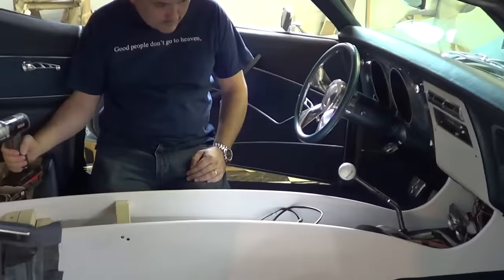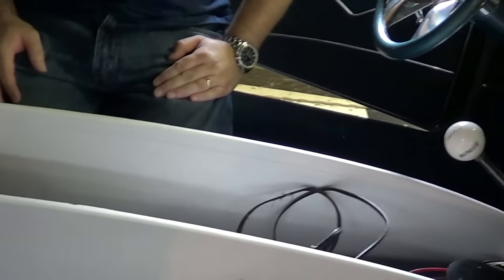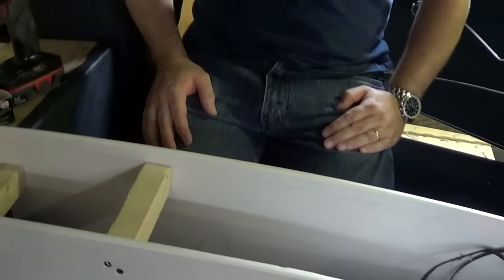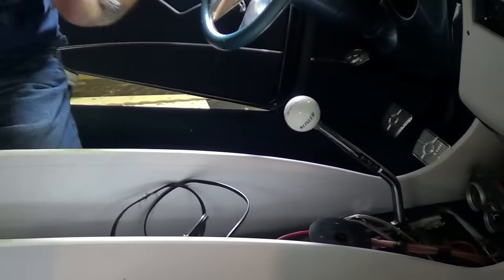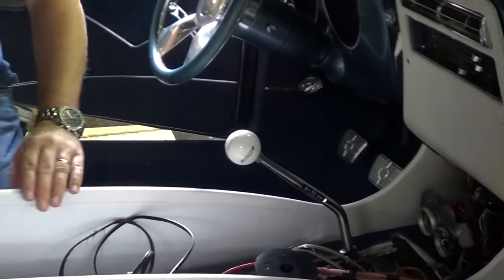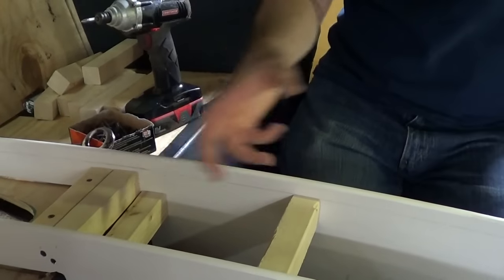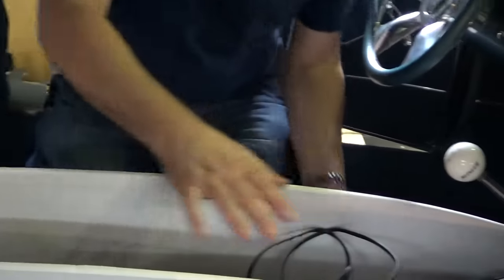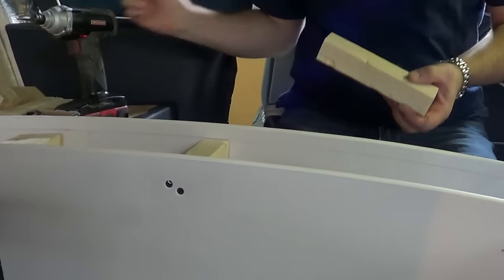Tim, boom — we made that cardboard turn into plastic. So you just laid those cardboard pieces on there and cut them out of PVC foam sheet. Now you're putting braces in there. I had to router these edges on a bevel — the bottom edge to match the contour of the transmission hump — rounded the tops over, then we cut these two-by blocks and screw those in, adjusting them where it's going to be linear and parallel so the door will slide easily. These blocks all have to be the exact same length to keep everything square.